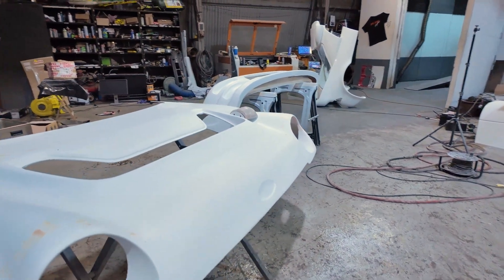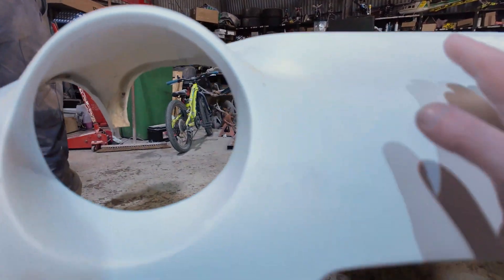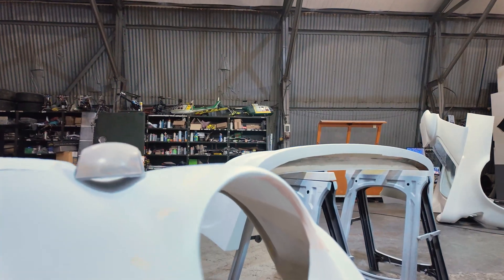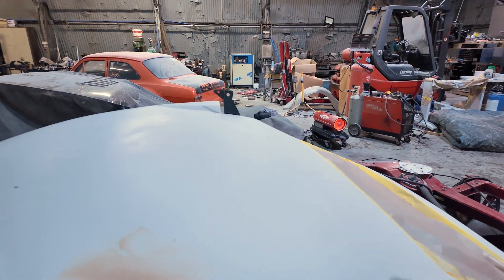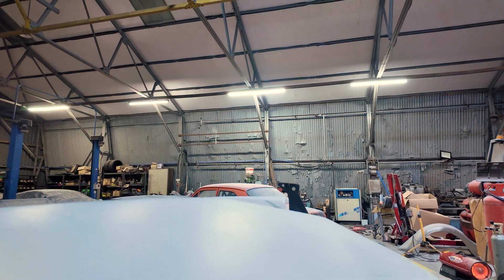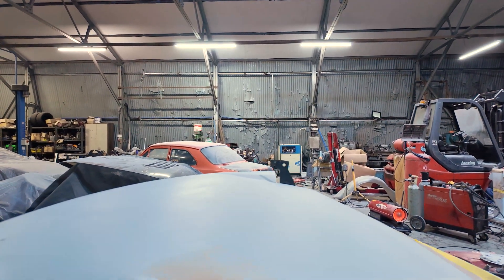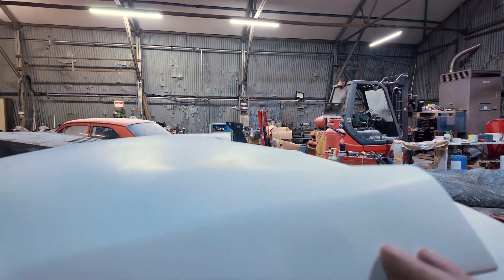So it's Sunday today obviously. I'm back tomorrow but I've got a little bit done — rubbed some of these, found some more. Pleased I spotted this bit under here, and there was some along here to do, a little bit on the roof. And I've got a low spot running right the way along the roof there that I need to see to tomorrow, but I'll do that once I've got all these pinholes done and the edges. Just don't want to guide coat it until I've got — you can just see the edge better when it's just white and you get a shadow.